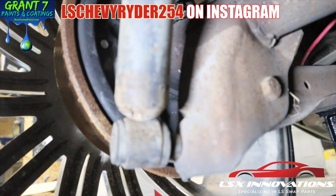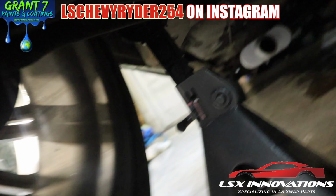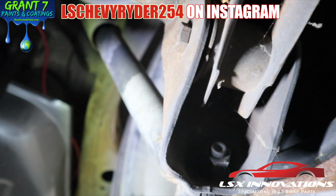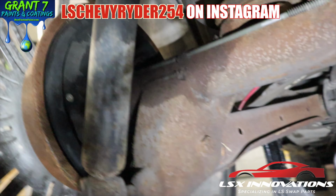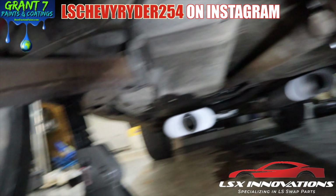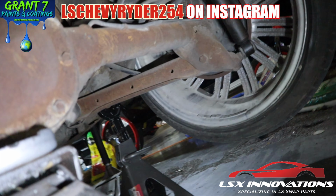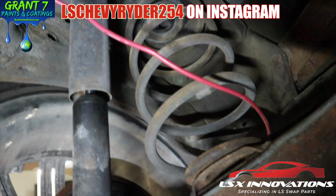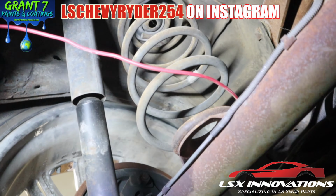I'm not gonna walk you through the whole thing. I'm just gonna tell you it's one bolt right here, and there's two bolts up there. Then pretty much this will come loose. Make sure you have your axle supported by a second jack. Make sure your car is supported on jack stands. Same way we did it on the box. And while we're back here, we'll go ahead and reroute this line to the pump. I don't know which way it's gonna go, but we'll figure it out.